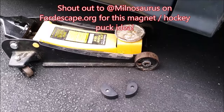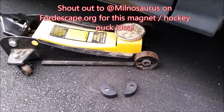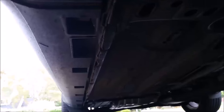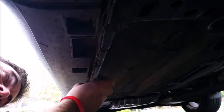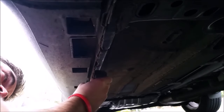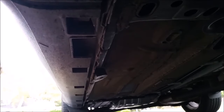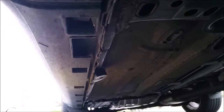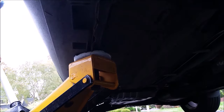If you'd really like to use a floor jack, try this trick with a hockey puck. Get a puck, cut it down the middle, and you'll have a spacer to put on top of a flat surface and behind your pinch weld. The magnet helps because you can go anywhere along the inside of the pinch subframe and stick it on there to still leave room for your jack stand. Then you position your floor jack and lower it as needed.